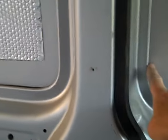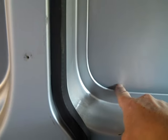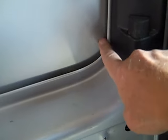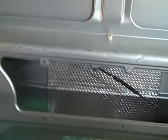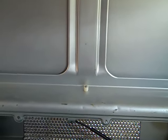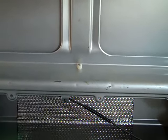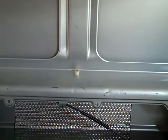As you all know, if you've seen my previous videos, we start off in each corner on the inside. We'll run round there, put 3mm little tiny holes there, 3mm tiny holes there, 3mm holes there, and 3mm holes there. Once we've gone through and done all corners, we'll go on outside. We'll join all the dots with a Sharpie. Then we'll go to outside and we'll chop that out with the jigsaw.